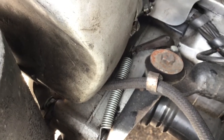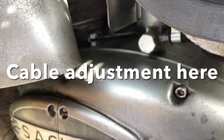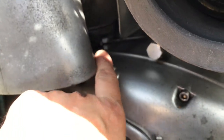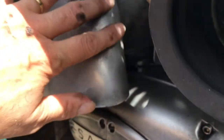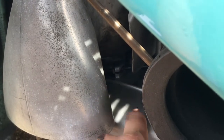If not, the clutch cable adjuster screw can be adjusted. The interior adjuster screw can also be adjusted and I'll show that in a moment. There's a screw — it's very difficult to see. It's easy to actually remove this cowling. I think it's a 10 mil just there where my finger's pointing — it'd be just a screw.